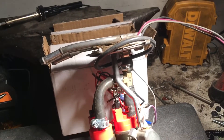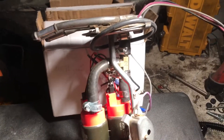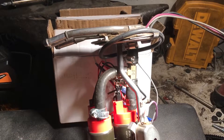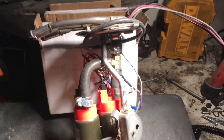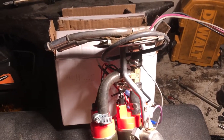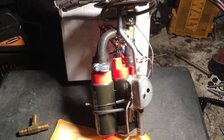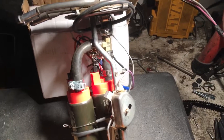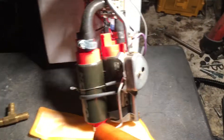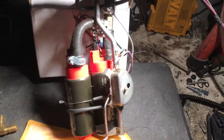I'm going to put this back in the fuel tank and we'll see how it performs, because the problem I'm having with my Buick is that boost starts coming up and once it passes 13 pounds of boost it starts stumbling. The fuel pressure doesn't pass 45 psi, and the pumps are supposed to hit close to 80 pounds — so I'm not getting enough fuel pressure for my boost. These double pumpers should give me the volume and the pressure I need, and I'm doing it on a budget.